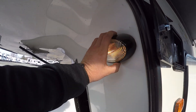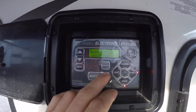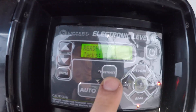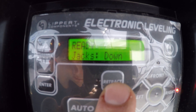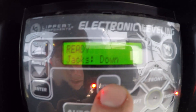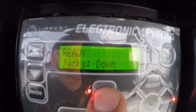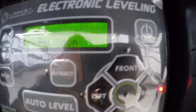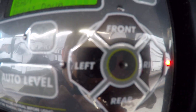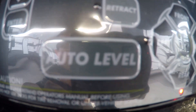That working light is for use at night. To the driver's side you're going to have your leveling system. For retracting the legs and bringing the legs back into the hydraulic system, you're gonna hit the button and it's gonna glow red. To extend and lower the legs, make sure that LED is off, then choose front, left, right, or rear to control that jack.